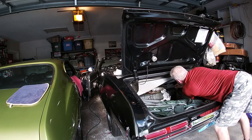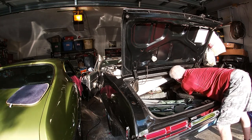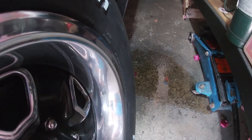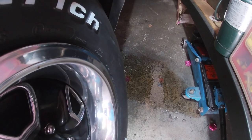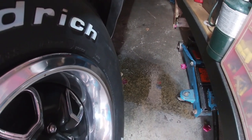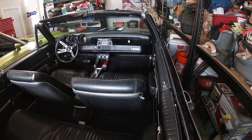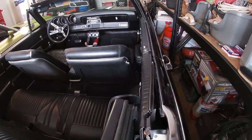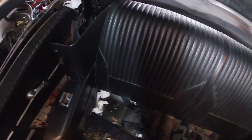This looks worse than expected — oil is coming out of the cover and a squirting sound is coming from the cylinders. This is the aftermath of putting the convertible top up during motor testing, which moved the weakest component from the pump to the cylinder. The cylinder has essentially exploded, pushing oil all the way to the front of the dashboard and making a big mess on the floor.